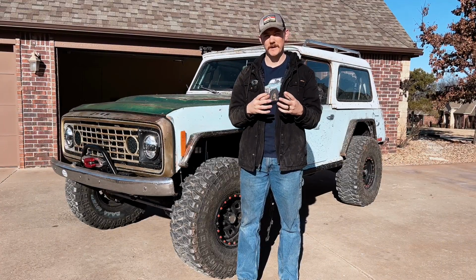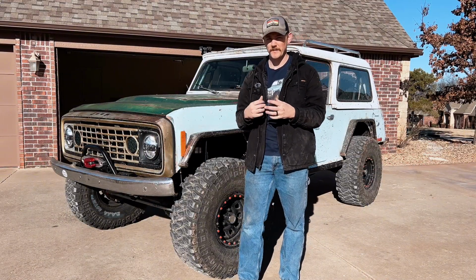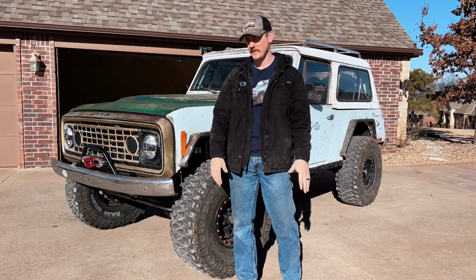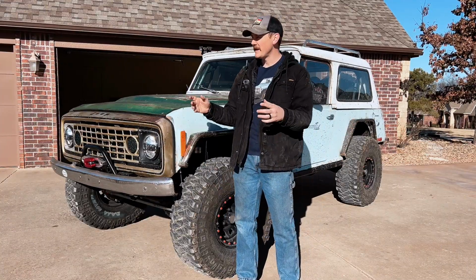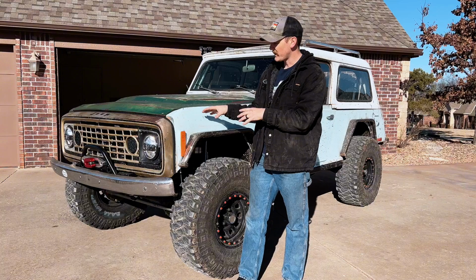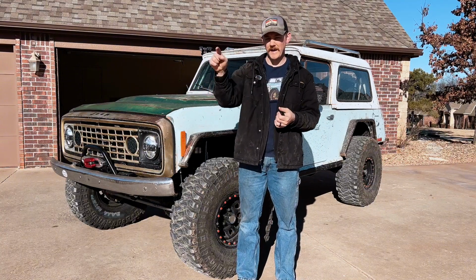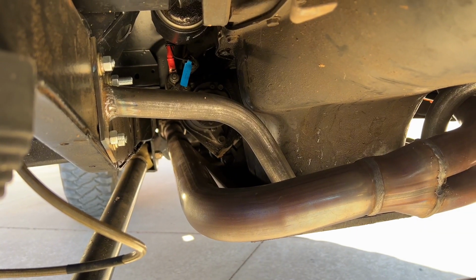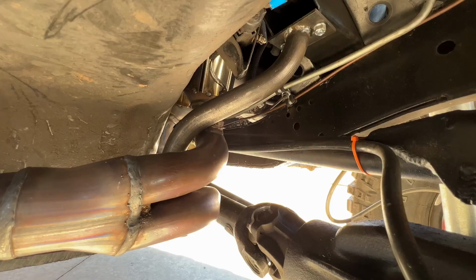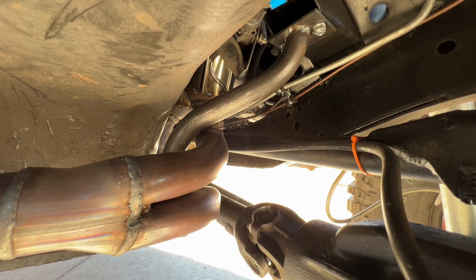After looking at it a little closer, since I have a 3-link design on the Jeeps, on the Commando, not Jeepster, sorry, somebody tagged me for that the other day. It's just habit at this point, guys. Since this has a 3-link on it, the right side has no upper link, so I ran that upper support to where the stock motor mount would have mounted to the frame. And then on the other side, I had to do 2 bends, so it came up, went over, and then back up directly to the motor mounts that I'd built on this.